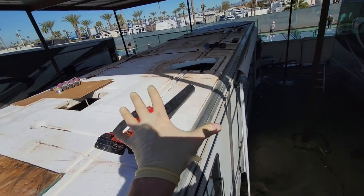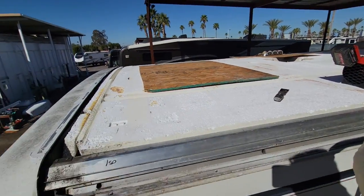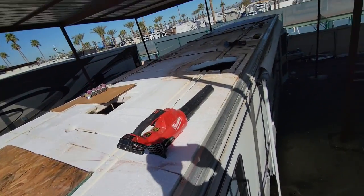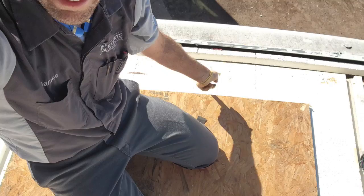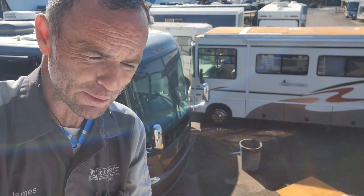These are not that vital — I don't like taking them out unless they've been deformed and are going to cause problems down the road. Luckily the back bedroom area right up to about the skylight isn't in bad shape, so I can start stabilizing the roof back there in the sun and work my way forward. I'm spreading my weight on this piece of OSB here, but you've got to be careful — on the foam itself you could collapse it. All these channels in the foam create lots of nice weak points for the roof.